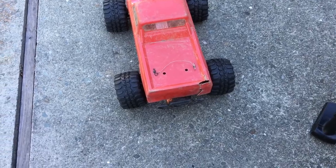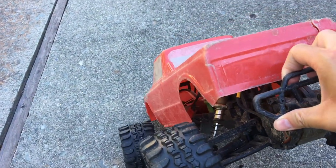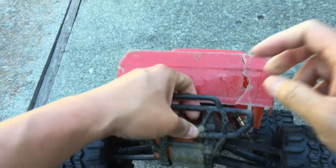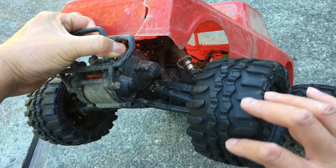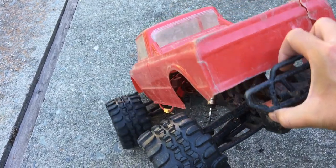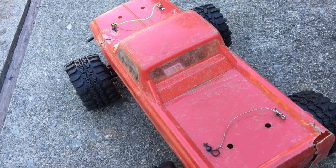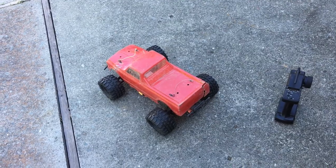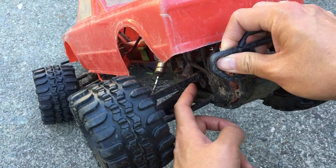Here's a bonus for you guys — literally right after I stopped filming, I decided to run down the pack a little bit more and snapped another drive shaft yoke. You'll notice on the other side we're actually using a steel Traxxas yoke there. We were just kind of waiting for this other side to give up the ghost, and unsurprisingly the 3S pack did it. Versus the 2S packs we've been running for the last couple of months, that drive shaft gave — the yoke just snapped an ear off. I can show you guys a closer view — that ear is snapped straight off.